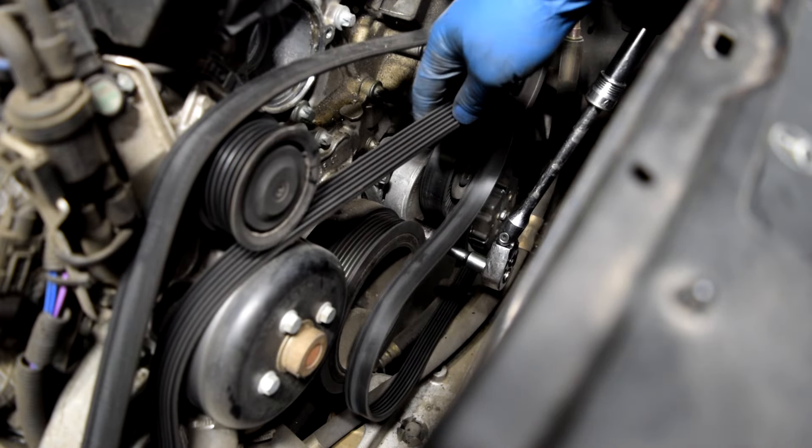Next we just pull on the cable that's in the back of the alternator and detach it. There's also going to be another connector that you might be able to take out now, or it shouldn't be that much of a hassle. Once we get this alternator loosened we're just going to pull it out, disconnect that connector, and then we should be able to clear our alternator.